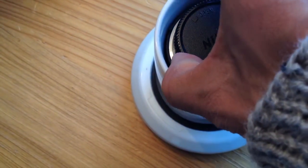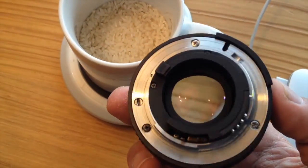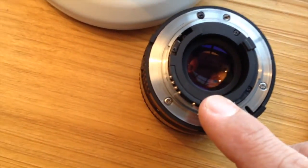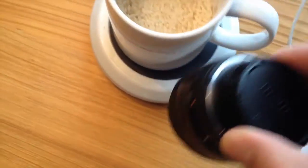Do not put the lens connection side down, because if you do that, not only does it get rice particles into the very delicate mechanisms, but it also leaches that water towards that end. That's not something you want to do. You want to try and suck the water out of the front end of this particular lens series.